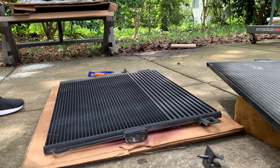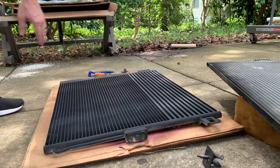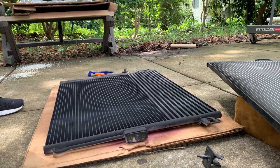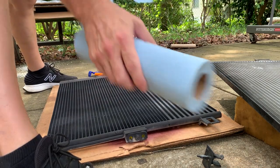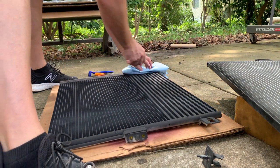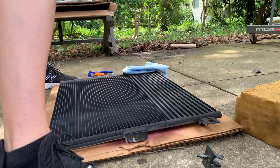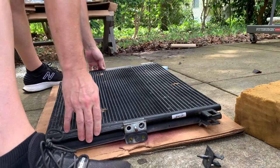Okay, make sure as you're doing this, you've got the AC lines to the driver's side and the transmission lines up and to the passenger side. Not too hard to get it wrong, but when you put these on, you don't want to put them back with these clips. I'm just putting down some extra towels over here so that when we flip this upside down, I'm not dripping trans fluid all over my brand new one. Get them lined up